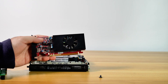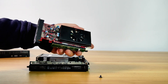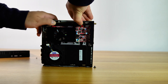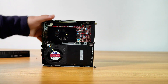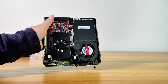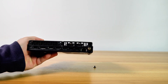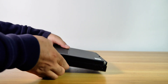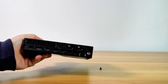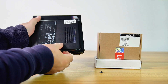You can indeed install a single-slot, low-profile GPU on this PC. However, powerful single-slot low-profile GPUs — such as the RTX A1000, RTX 3050, or modified versions of the NVIDIA RTX A2000 and RTX A4000 ADA SFF — are typically expensive. Additionally, they tend to run hot in this compact system and can be quite noisy. The GPU I installed on this PC is an RX 6500 with 4GB of VRAM. It runs older titles well, but struggles with most recent games, such as The Last of Us Part II Remastered on PC.